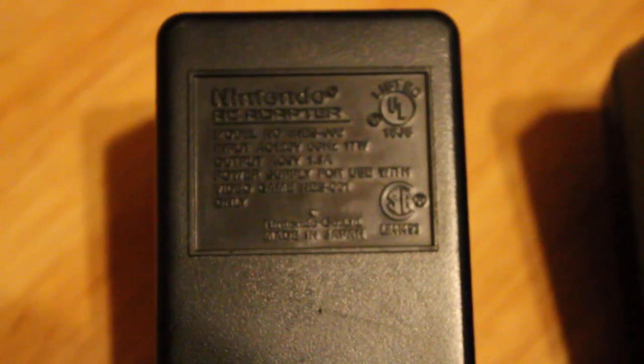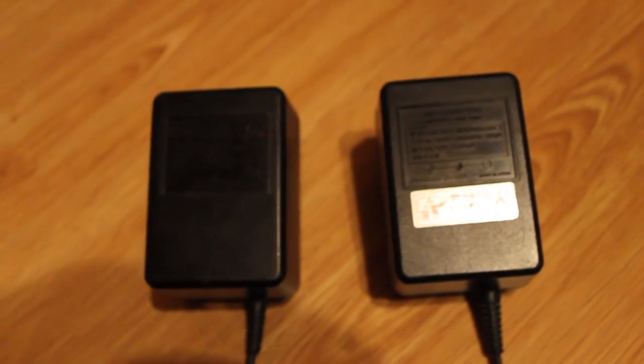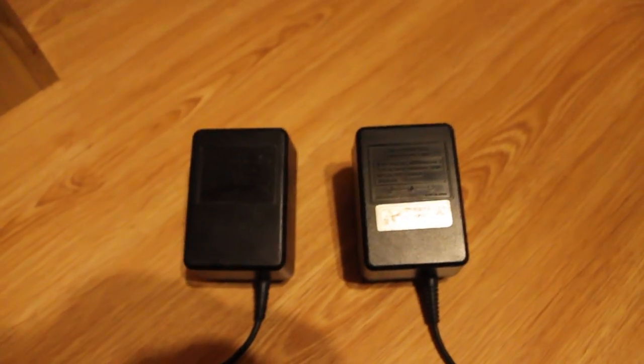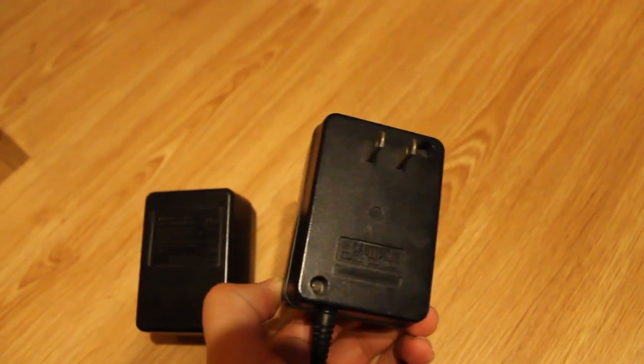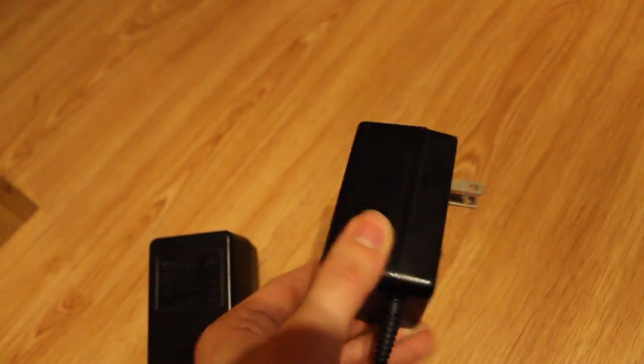The last and probably most important thing to remember when importing a Famicom is to use the original Famicom AC adapter. Apparently the NES adapter outputs at a higher amperage, and supposedly you'll melt your motherboard. I haven't tried it myself because I don't feel like wasting a perfectly good Famicom. You're going to either have to get a transformer to convert the amperage to an appropriate level, or just use the Japanese version. From what I've seen, there are zero issues using the Japanese AC adapter on the American power grid, and I haven't run into any issues so far.